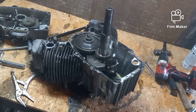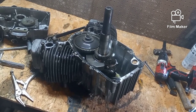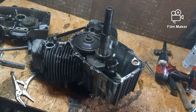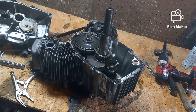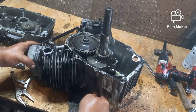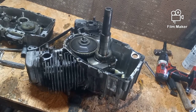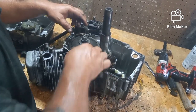I can feel the piston right there, so I don't think there's going to be any damage on that far of it. And I'm not even sure why there would be damage on that press fitting, that bushing is the word I was thinking of, on the top of the crankshaft. This is the bottom, but on the top, remember we had the wobble. Just normal wear and tear. So I'm literally taking this entire thing apart to make sure that there's no other damage anywhere on anything, that there's no broken pieces, that there's nothing missing. And take a look at that crank and see if there shouldn't be any damage to it. The bushing should have worn well before the crank. The bushing is made of sacrificial material, softer metal, and the crank is hardened. So I'm not expecting any issues there. So let me go ahead and make sure.